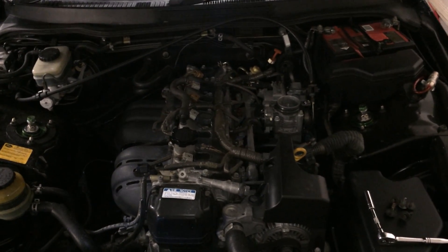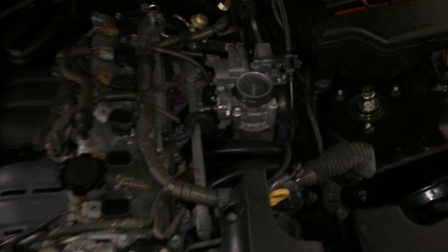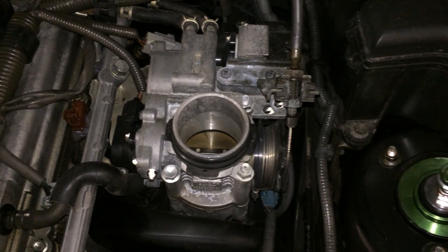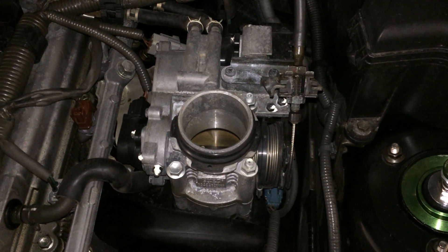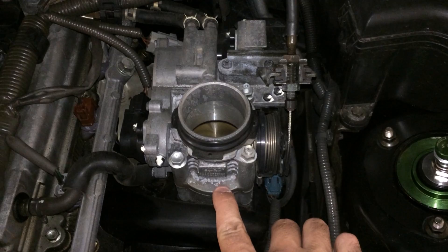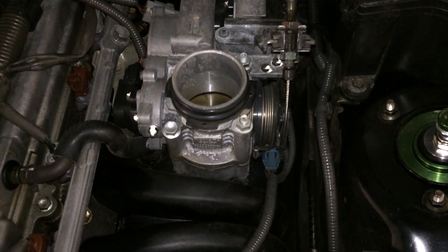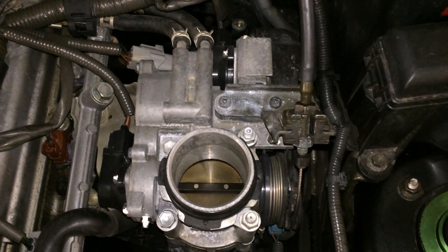But plain and simple, the reason why it's so uninspiring is this throttle body. It's one of Toyota's first attempts at a fly-by-wire. They've been doing a double throttle body setup for ages with two butterflies — one here and one there — in the 1Js for a while. But this is really their first attempt at a single butterfly that has electronic throttle control.